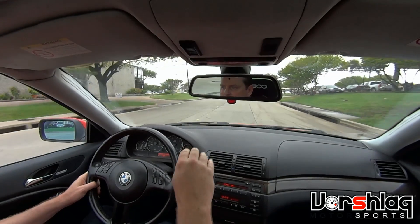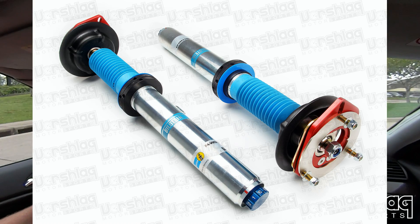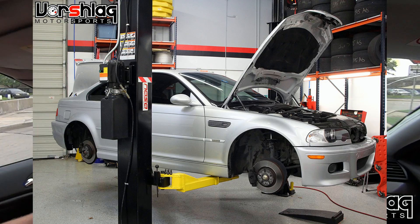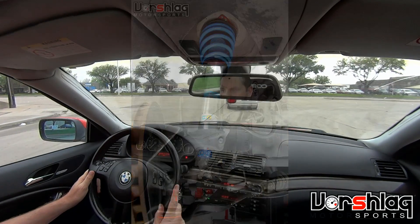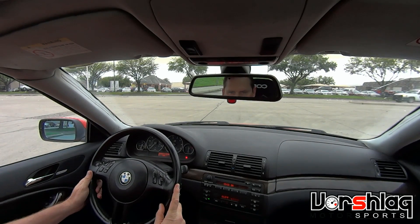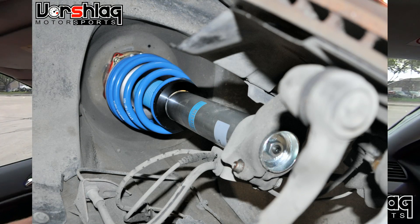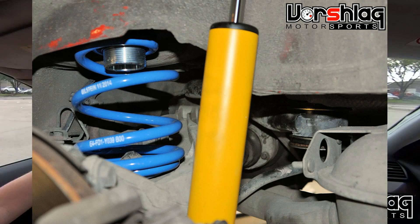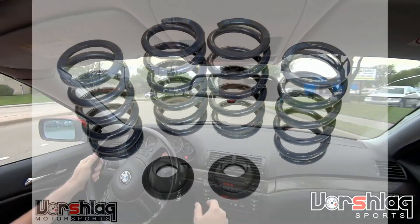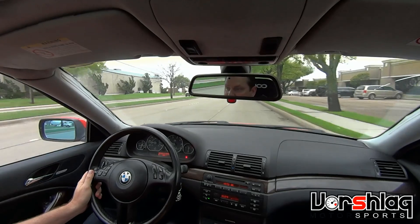On some of the rough stuff it's a little slow to compose itself. We probably should have gone with the Bilstein PSS 10 kit — they only make that for the E46 M3, which we could have easily adapted to this car. But it was a bit of a mistake. This is a really inexpensive kit — I think it's like $1,100 or $1,200 for the non-adjustable PSS — and you still get four-corner ride height adjustability and you can easily change the spring rates to a true 60mm coilover spring like we've done on this car. And it rides really well.